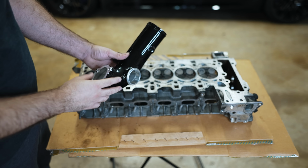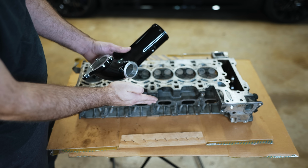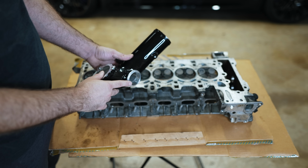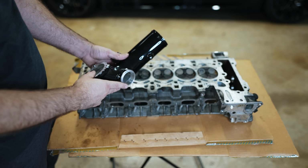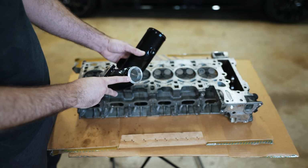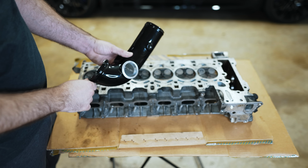It'll definitely be a less dramatic blow-off valve effect because you don't have an abrupt throttle closure and because of the way the system is designed to mitigate boost. So you'll have to be deliberate to get the sound. It's not going to really have much of a play under normal circumstances. You just have to be a fan of old school turbo noises to bother. I'm doing this in preparation. Maybe one day I'll upgrade the turbo on the B58.